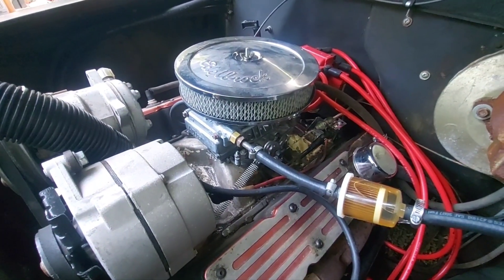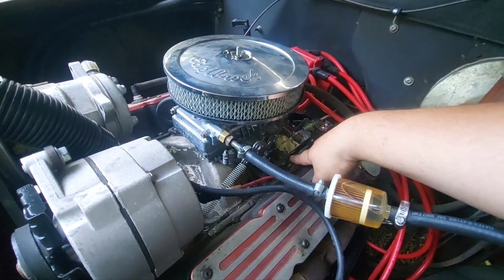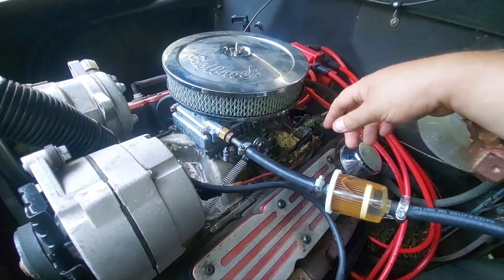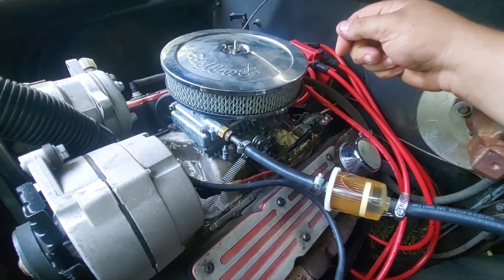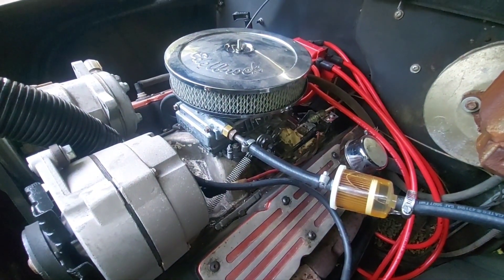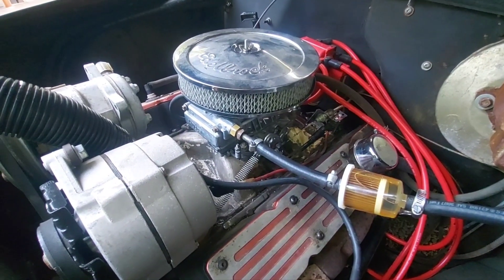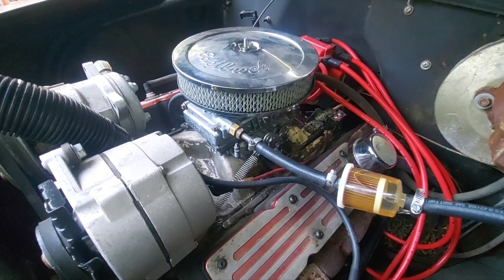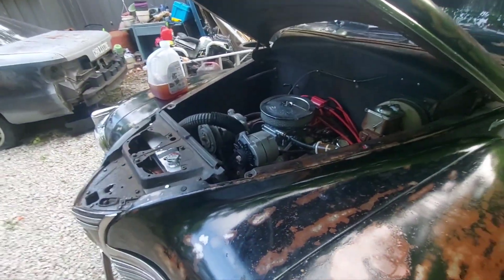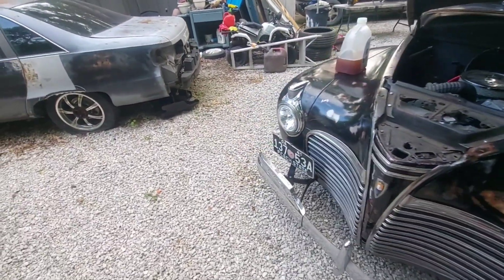Timing is all figured out and the new bracket is working flawlessly. However, the kickdown is still not kicking down at the transmission — the S-clip connection at the trans is probably not hooked up. I've got a return spring on it but it's inconsistent. That'll be fun to fix. For now, going to jack her up and put the front shocks on — not going to be easy since I don't have a compressor right now.